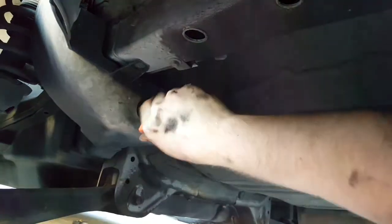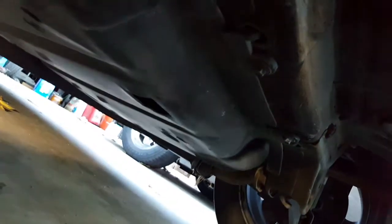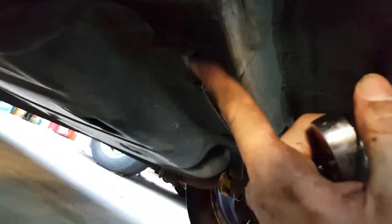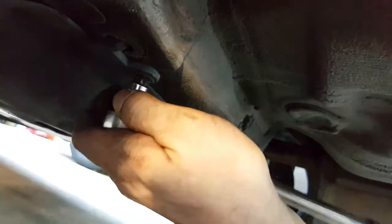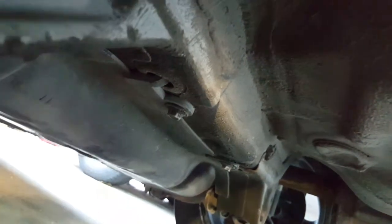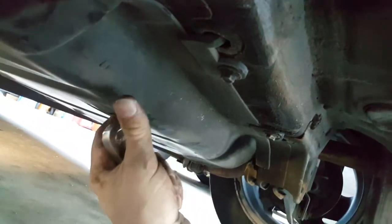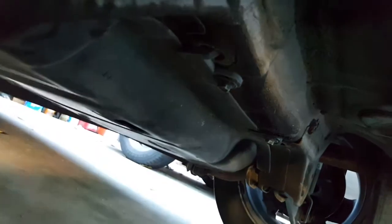Once you've got that turned off, you've got this little panel here — this little panel right here which is where the gas tank would go if it wasn't in your trunk holding natural gas. You've got a couple bolts to take off; I believe they are a 10 millimeter bolt. So you want to take this little plastic panel down. You don't have to take the whole thing off, you just want to get it so that it's on the ground at an angle and then you should be able to get to the canister, which I'll show you in just a minute.